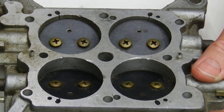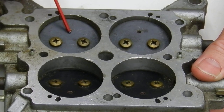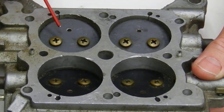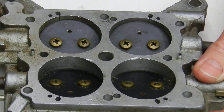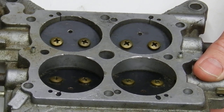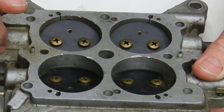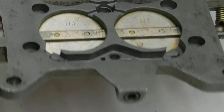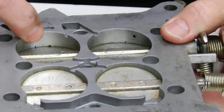When you do this, it allows more air to bypass the throttle plate through these holes, and it lets you close the throttle plate down because your idle will come up — it's bypassing air. So you'll drop this screw counterclockwise, and that's when it's actually going to start coming down.